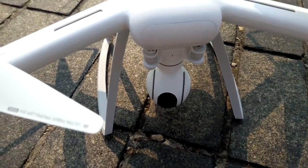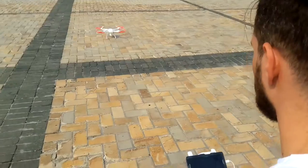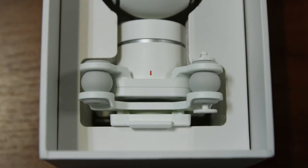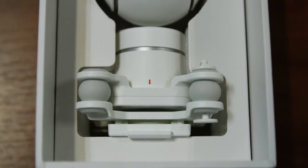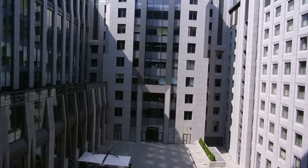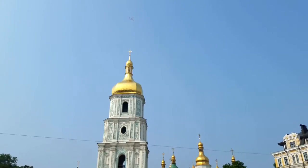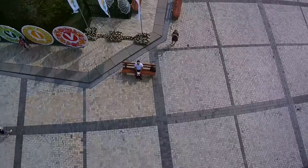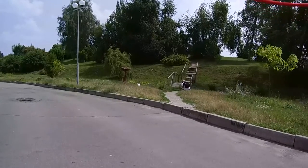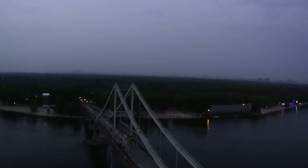The camera is a ball-shaped, futuristic-looking thing with a recording indicator and a WiFi connection indicator. The video signal passes through the drone and the remote before reaching the smartphone, which enables the 2 km operating range. The camera is built into a 3-axis gimbal connected to the drone through a vibration-absorbing platform with four flexible rubber feet. This eliminates vibration from the drone body, and the 3-axis gimbal not only stabilizes the shot but keeps the frame exactly the same independent of the drone's movement. Even the most fierce maneuvers do not tilt or skew the video, and the gimbal allows the camera to look up, down, and slightly to the sides — the copter's feet never enter the shot.